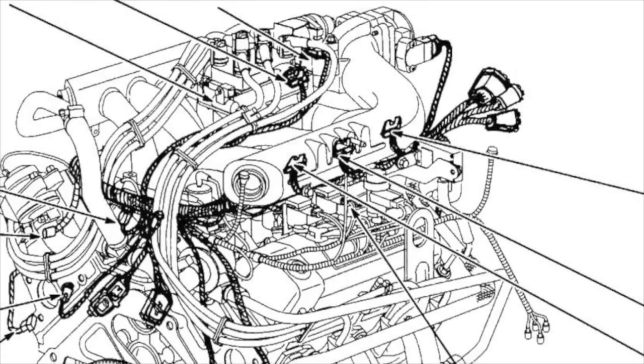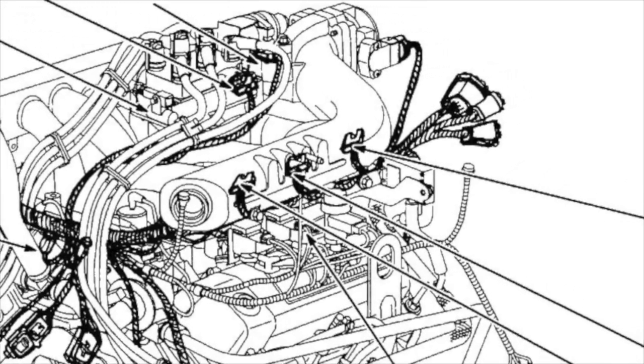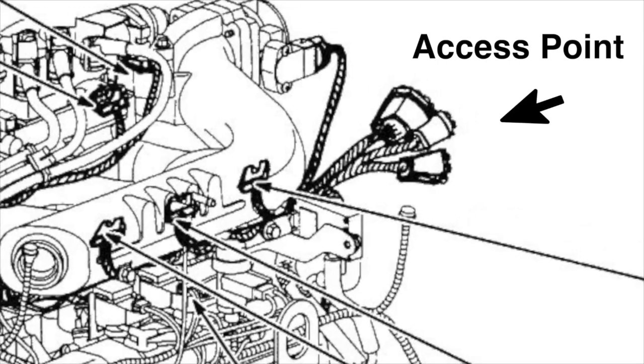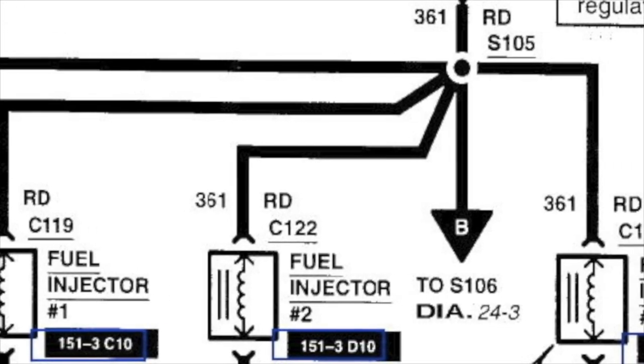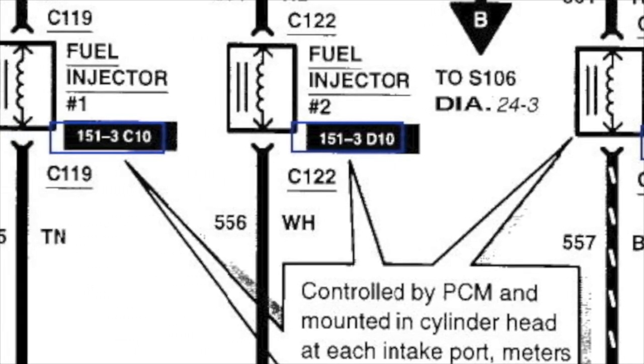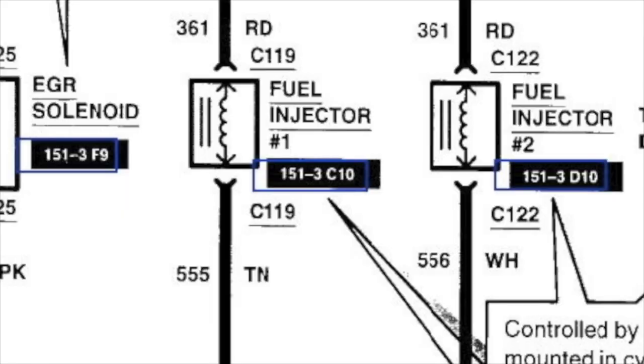In my information system I look at the wiring harness, and it shows me I don't have to get all the way down to the injector to tap into it — I can follow the harness back up to an easier access point. All injectors have a common red wire that provides power, and then a different colored wire to each injector to command it on. Injector number one has a tan wire on the ground side, so I need the red wire and the tan wire.